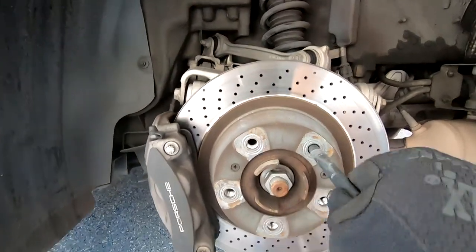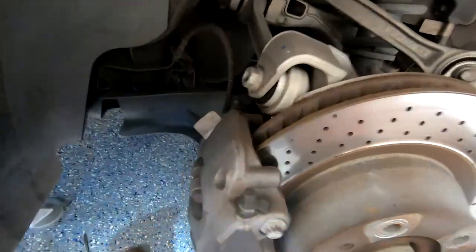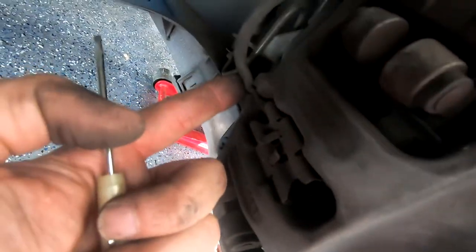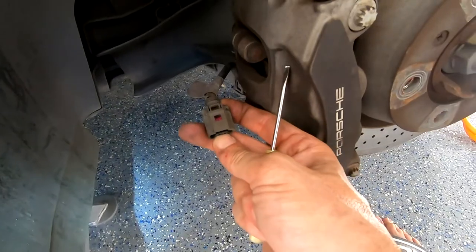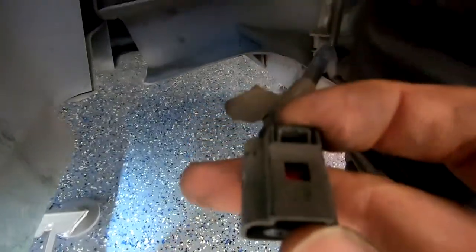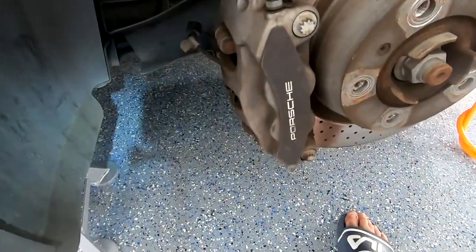The first thing to do is disconnect the brake sensor wire — it's easy to find. The wire is connected to the brake pad. I see people online having problems disconnecting this connector, but all you do is place a small flathead screwdriver in the top, pull back slightly, and then slide the connector right out. Right there — pull back. It will simply disengage the connector and then you gently pull it out.